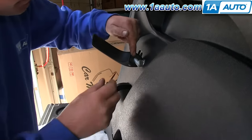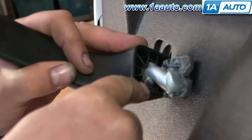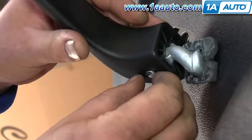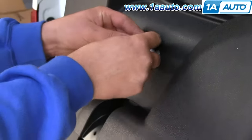On the other side of the door panel, where your door handle is, you want to pry out this little rubber pad here, and you'll see there's a small clip. Just pry that out with a flat blade screwdriver and that small piece right there will come right out. Then just pull that door handle off and push that metal part through the door.